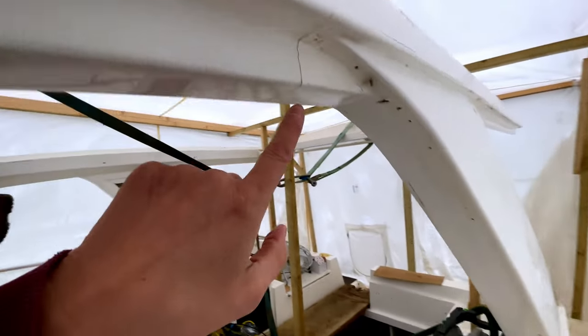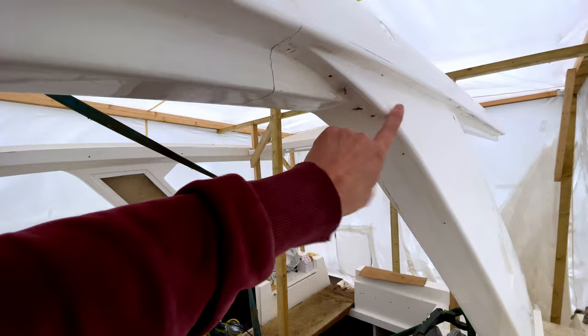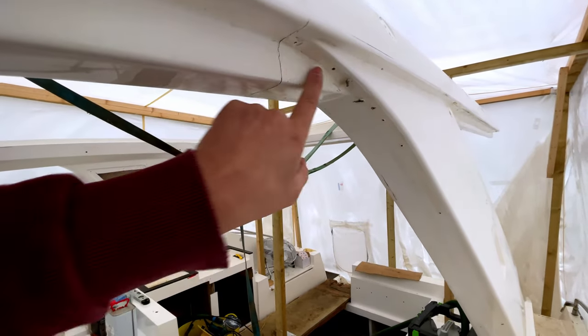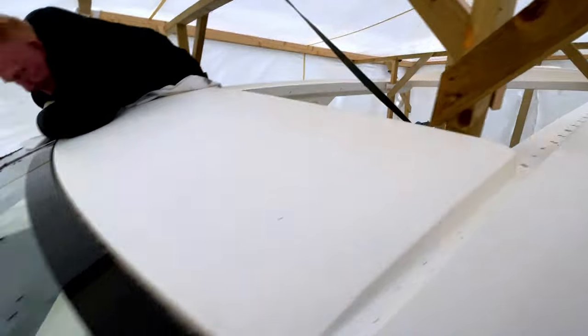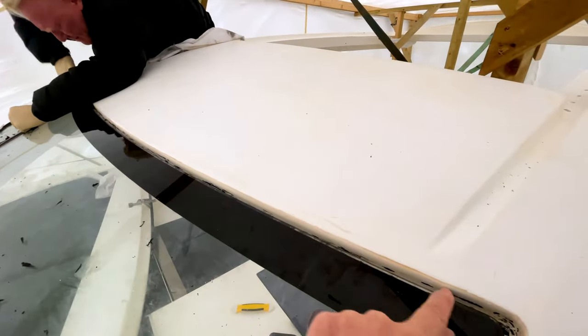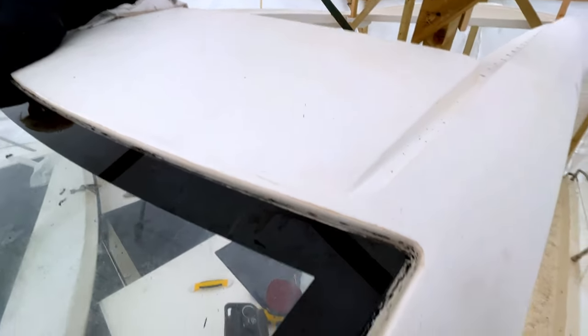And we've got the joint up here as well, which I was talking about earlier. So this is where this B pillar is joined onto this top and bottom molding. So again, that'll just want sanding, but that won't take too long. And Richard's just cleaning up this channel here, this window channel, so that we can get the paint inside there and then reseal it. But it's quite a task getting this adhesive out of here, but getting there slowly with it.